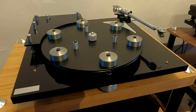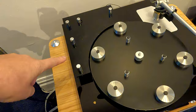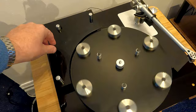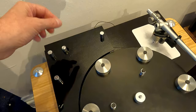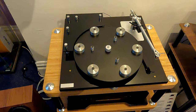Let's have a closer look at the design. Operationally, the tonearm is the same as a Rega arm - just lift, lower, move the arm across, totally manual. On this panel here we've got various things. These three are just attaching the panel to the deck. That one, which just looks like another attachment nut, is actually the on-off switch. If you just rotate that, you hear a little click and it starts. And this little device here - it lifts up and pulls the belt onto the next size of pulley. So it's like your manual speed change on a Rega, except there's a little lever that pulls it up and down so you don't have to disassemble anything - just a very clever engineering solution.